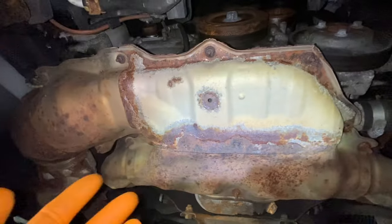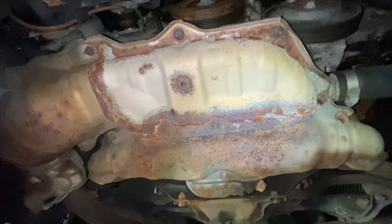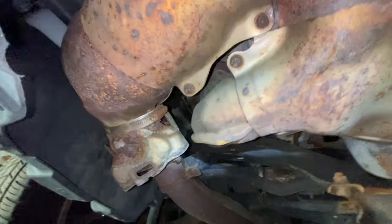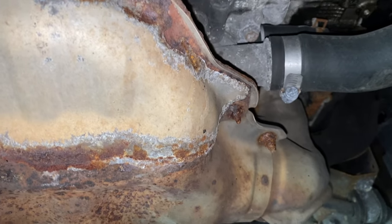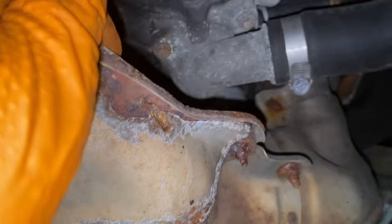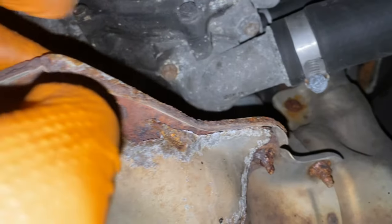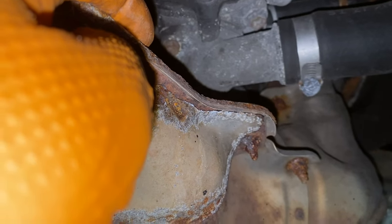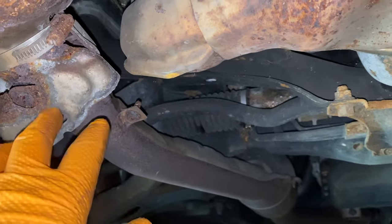What I'm going to do — like I said — I'm doing the engine on this car, so I'm just going to take it off, but you don't have to take it all the way off unless you want to. What I'm going to do is release those three bolts on each side and just lower it a little bit. The exhaust manifold bolts and nuts are 14 millimeter, not 13. I loosened everything and you can see — if you pull it down you can get to it. If you don't want to take it off, you can just loosen from the top and bottom and pull it down to give you enough room.